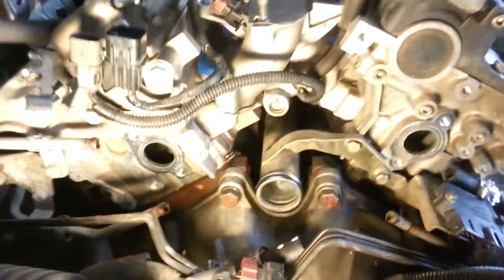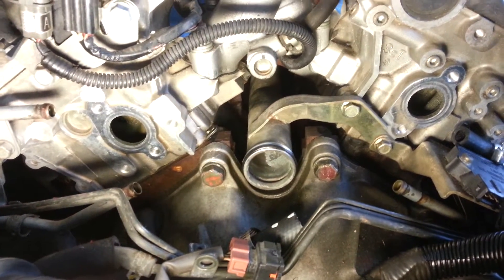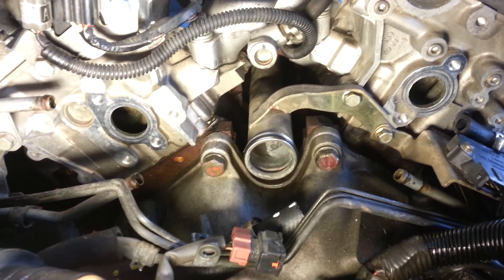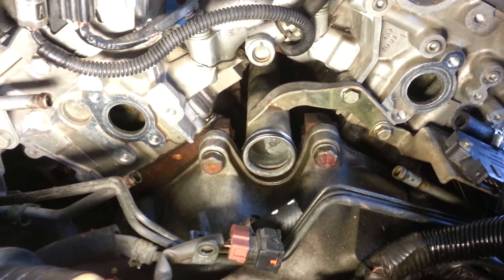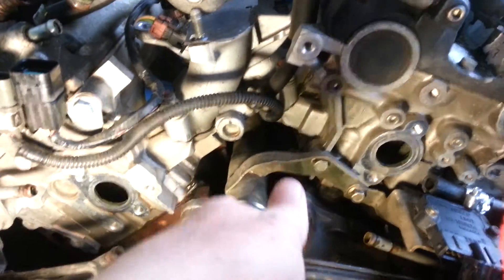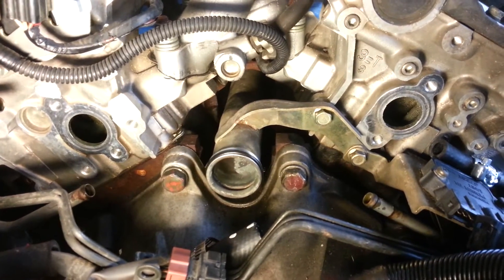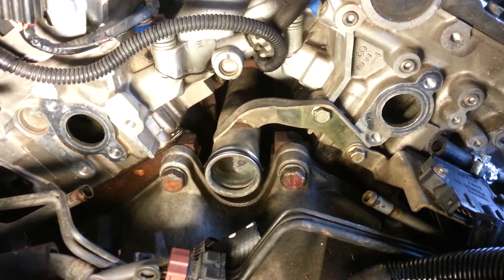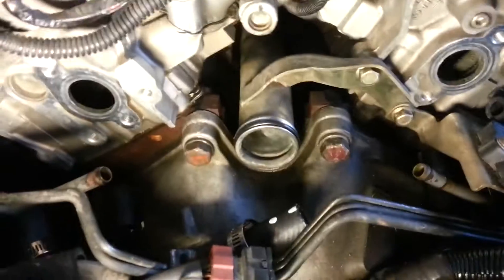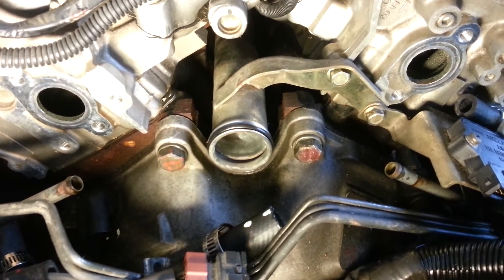Just clean up the tips. You'll notice I've also installed the coolant tube. I did that immediately after installing the water pump, so just less chance of contaminating the silicone on those seals. What I do is I install this arm kind of like at 12 o'clock, and then spin it towards the 3 o'clock position as I'm putting it in, just to keep from rolling the seal. If you put silicone on the back of the pump, like I suggested, then the risk is pretty minimal.